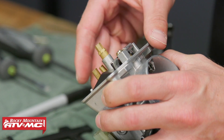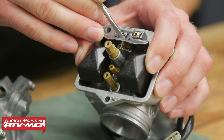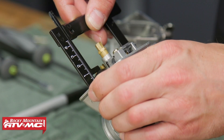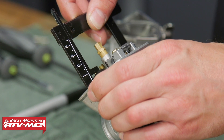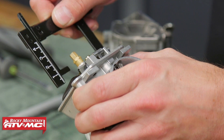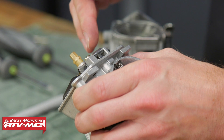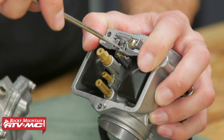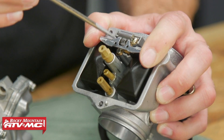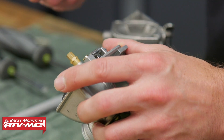So that's when you're going to have to adjust that tang. To do that, all we need to do is press in on it a little bit — it shouldn't take a lot of force. We're just using a flat blade screwdriver and making small adjustments so it doesn't get way off. With it right there, it is barely touching our gauge, so we know it's in the right spot. Now, this is what that lean condition is going to look like — you have the float in the correct spot and the gauge set up correctly. We'll press this down and that highest point actually pushes on the float. So that's how you know you're going to be too lean, and you definitely want to get that adjusted. In this case, you're just going to lift up on that tang with a small screwdriver. You can work it from both sides — just be careful you don't damage anything. You'll keep adjusting until it's in the correct spot.